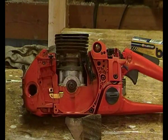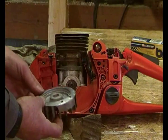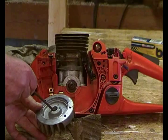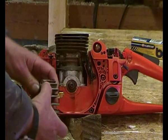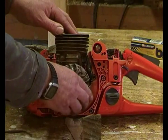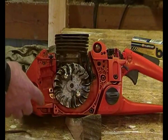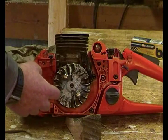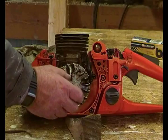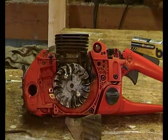Make sure your ignition unit is very clean and all nicely cleaned out before you start. We've covered flywheels in several videos but we'll do it again briefly. There's a quite steep taper, a keyway and a key in there, so it's self-centering and quite accurate. You just pop it on - don't push hard - and the key drops into the keyway and it all drops onto the taper. A taper is an engineering way of getting something accurate: it locks on and holds very accurately. With a parallel shaft the slightest wear gives you rock, but with the taper it just tightens up.